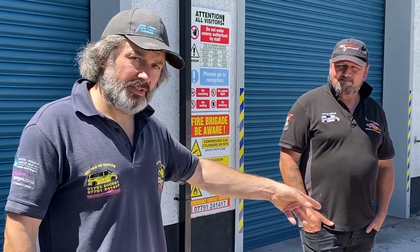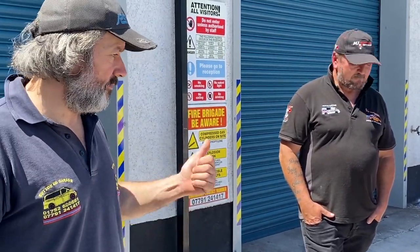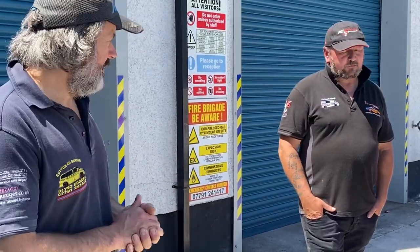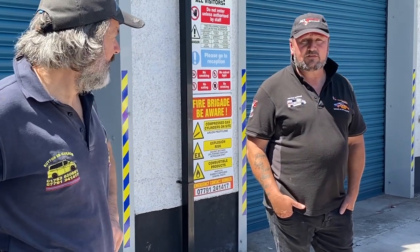So we beefed up the rears. We put a hook groove disc on the rear to match the front, and DS2500 race pads on the rear to match the front. Then Rich took it out on circuit and will explain what it does. It was brilliant front end wise, but turning into corners you'd get a bit oversteery, with braking oversteer.